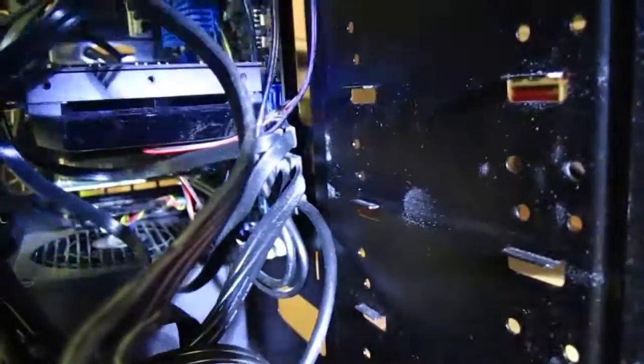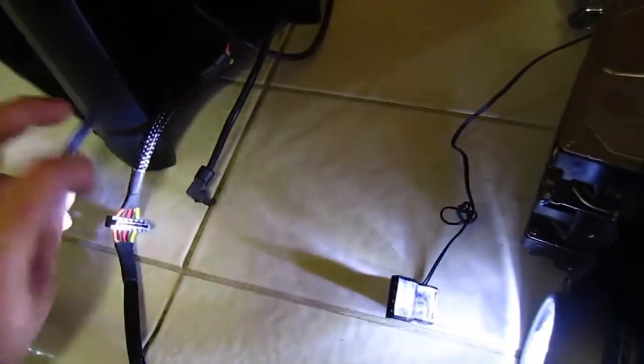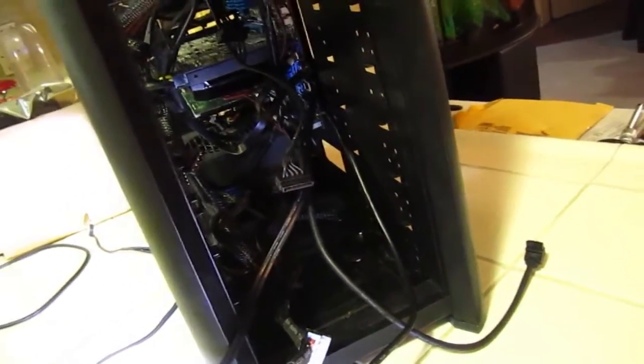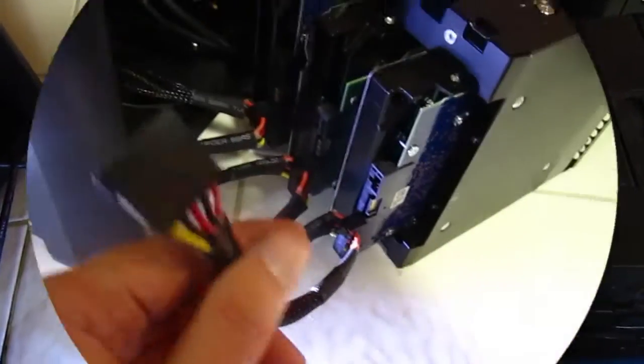Right there you can see where all the SATA cables are connecting. I've disconnected all the SATA cables except for the 2 optical drives because now I'm going to do some rearranging. Look at how the different models have different colors. I never really explained the upside-down power connectors — the ones that come with the power supply are upside down for me because the power supply is expected to be at the top coming down, but this case has the power supply at the bottom. So that's why they were upside down. I'm going to try to use them on these bottom 3 hard drives.